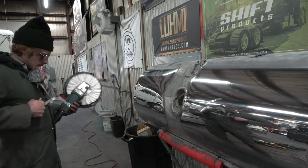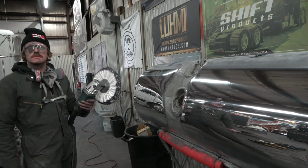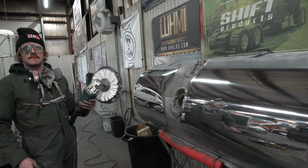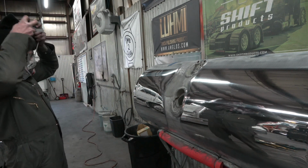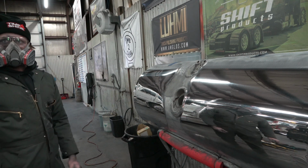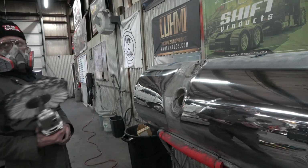Okay. And when jumping from show green to show purple, they're not a whole lot different. So you don't necessarily have to clean in between as long as you didn't leave compound behind, right? Yeah. If there was compound behind, we would use chrome polish to wipe it off. And then you would try to clean as much of that hand polish off from the chrome polish as possible because you don't want any of that contaminating your buff. But if you push too hard, you're gonna scratch it. So it's a double-edged sword. So I just try not to clean in between the two. Okay.